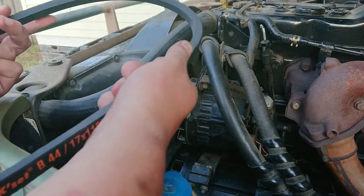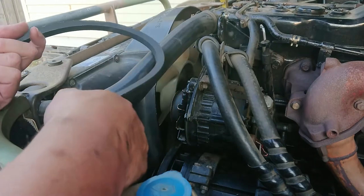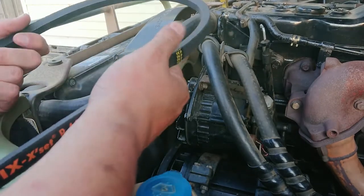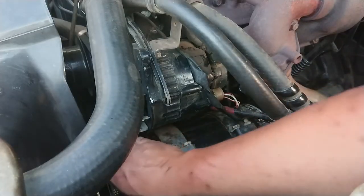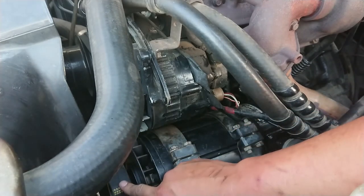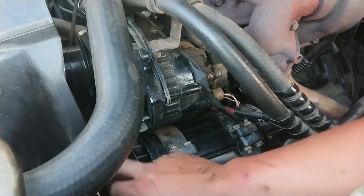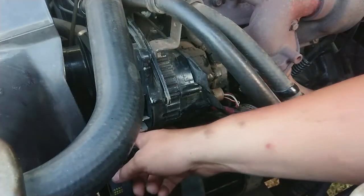I think I've probably got enough here to do the job, but I'll put both belts on and see how it goes. If they have a catastrophic failure it won't stop me getting anywhere — it'll just stop the 24-volt system charging and probably throw a chunk of rubber around. The belts are in and tensioned. I'm a little uncomfortable about how wide they are, but now they're tensioned they fit sort of okay — I could probably stand to put narrower belts on, but for now they'll work.